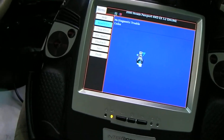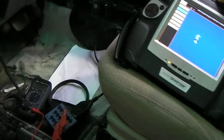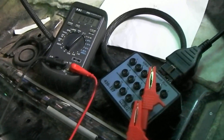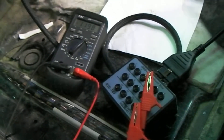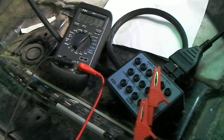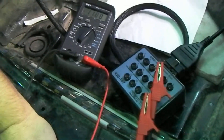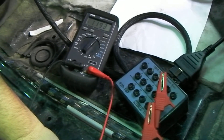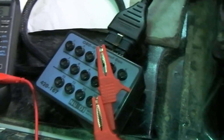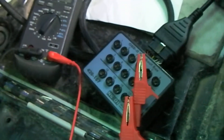A lot of times a car will come in and you'll hook up a scan tool to it and you'll see that there's no communication. And that doesn't necessarily mean that the car's not capable of communicating or that it's got an actual communication problem. There may be an issue in your data link connector. So anytime you're diagnosing a data link connector, you can use this breakout box. On a lot of old cars we used to use them a lot more, particularly Fords, for just regular electronic control system diagnosis. But today this particular breakout box is still useful.